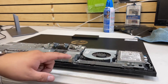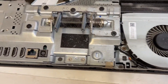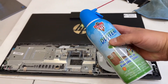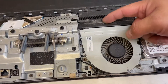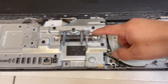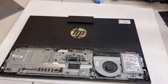Now you can see the actual hard drive and the fan — it's a perfect moment to do a nice cleanup in here, because you can see how dusty it looks. Make sure you get some compressed air. You can get Dust-Off at Costco — it's the best one on the market. Use the compressor to blow out this whole area. You can also remove the two screws to clean the separation between the cooling system and the fan. Once everything is clean, remove the screw to take the drive out and put the new drive in.